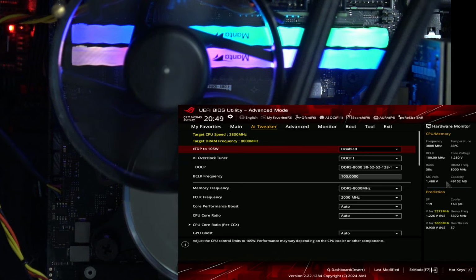Though I've not run into AM5 having pressure issues like LGA 1700 does. With LGA 1700, if you tighten a heatsink too much, you can get it to stop recognizing the memory by just over-tightening the mounting hardware. Or not tightening it enough, both ways. I've not run into that with AM5.